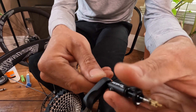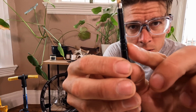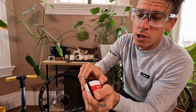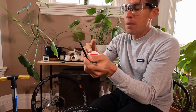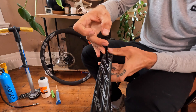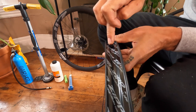You've got your keeper nut and your washer, so we're going to pop those off. This is the valve core — you can see there are two O-rings and a little hole right there, that's the important part. Make sure that the O-rings are in good shape. SRAM recommends that you take just a little bit of grease and dab it on the O-rings, making sure not to get it into that little hole. Make sure that the grommet matches up with the groove of the rim gently so as to preserve the O-rings. Insert it all the way down — you can see that the grommet and the rim fit right there. That's super important.